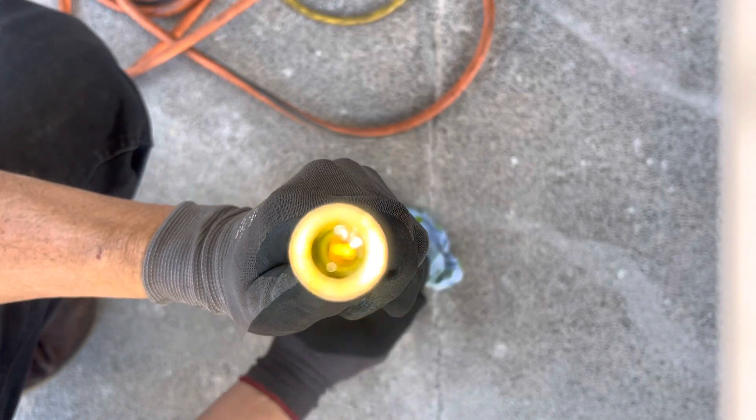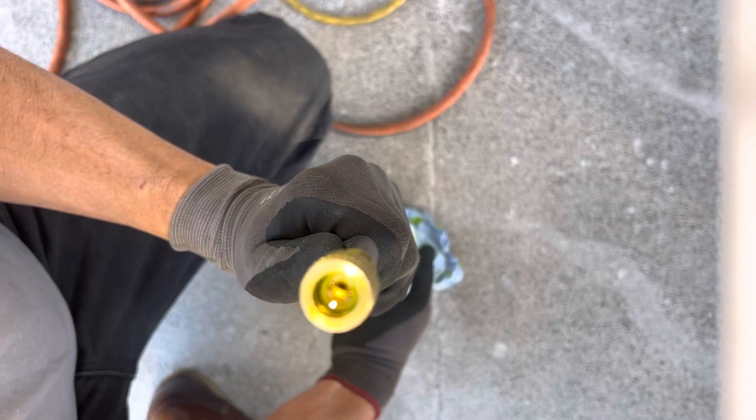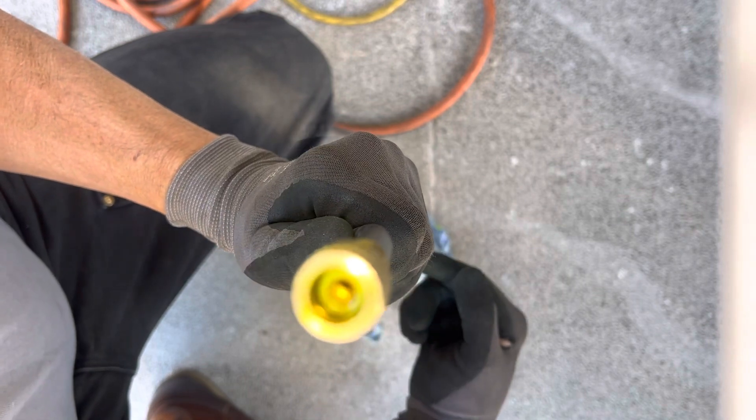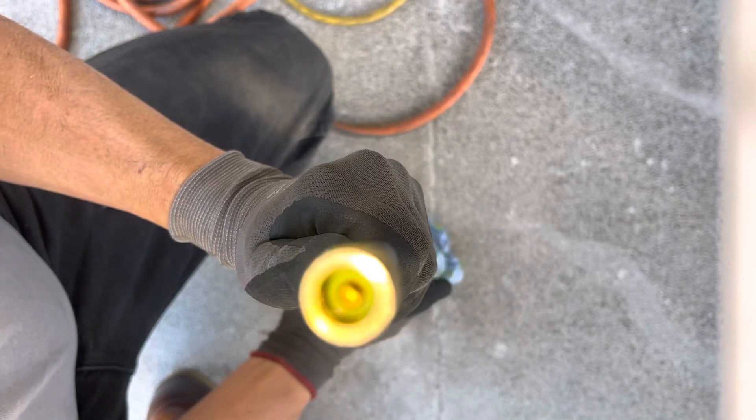Let's say you're a do-it-yourselfer and you don't have a lot of money, so you could only afford one injector and it's already on your gauges performing the vacuum. I just happen to have this system under vacuum right now — I started it and then decided to make this video. To purge the air: hold it upright and we're going to purge until we see the little bubbles in the top coming out — that's the air. Hold it perfectly upright, turn it, driving the piston up, pushing the oil up and pushing the air up.